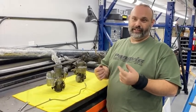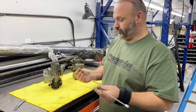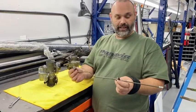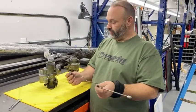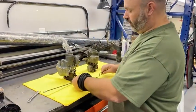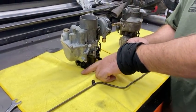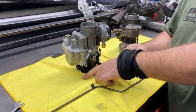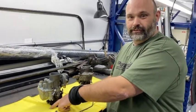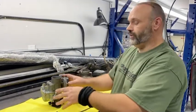So I'm going to try to fabricate a cap and we'll see if we get close, and hopefully somebody will turn up with a picture one day. Since we're stuck with only modern parts available, I've changed the brass fitting so it accepts a brake line. I'll use the brake line to snake around the back and bend it down to where the heat hole is on the intake. We'll fabricate something similar to the factory retrofit kit, and once that's done in a day or two we'll shoot some video and see how it works, then get into tuning the carburetor.